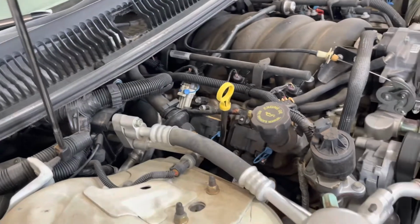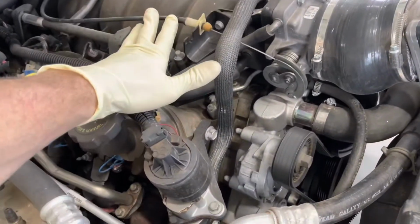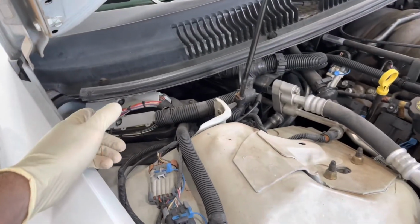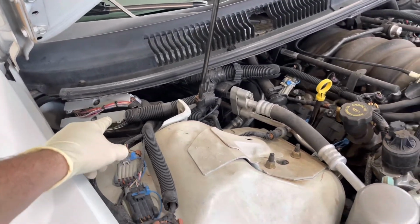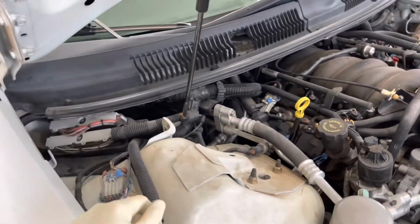If you guys remember the last video, or if you're new to this video, the whole wire harness for the engine, it gets laid on top of the motor and it gets dropped with the motor. So I'm gonna do that and pull the PCM out and flip it over. Plus, that PCM is going to get sent off and get reprogrammed for a couple of the upgrades that I'm going to do on this.